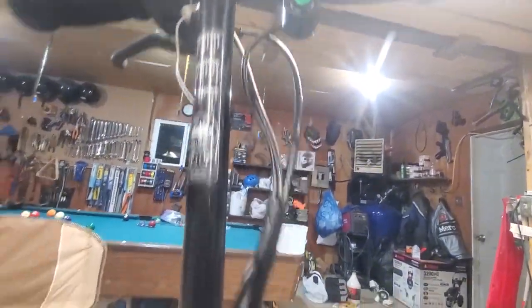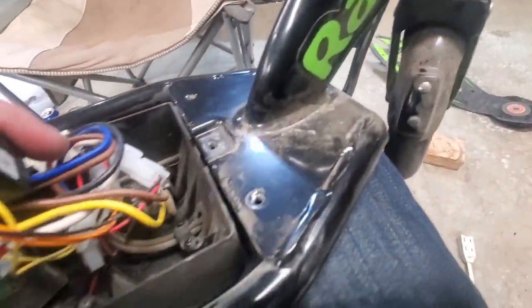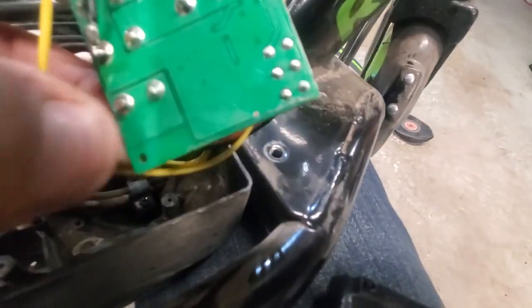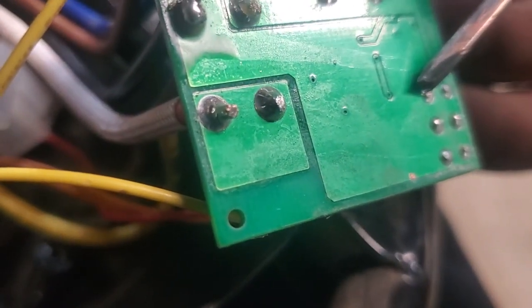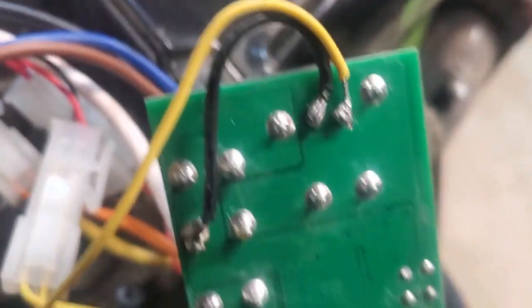What I did is I traced these wires. Turns out that button just completes the circuit — that's all it does. You want to trace those wires back here, find out where they go. The one that gets power already — you can follow that line. So that is your power wire there; that one we left alone. When it comes back from the switch, it would go here. It has to sense this relay somehow with all the electronics on here — it has to sense voltage from the motor first, which is why you have to be driving it for it to kick on.